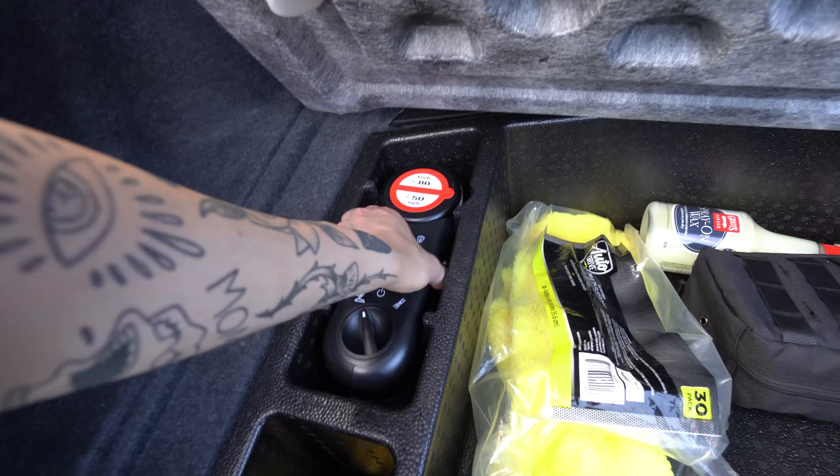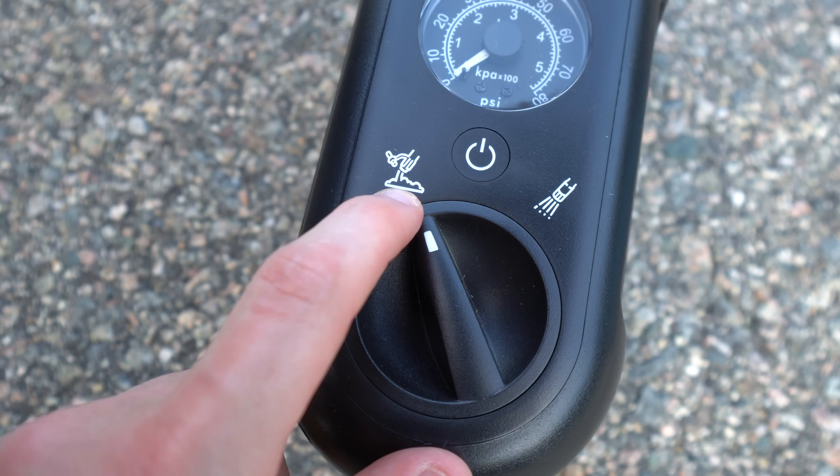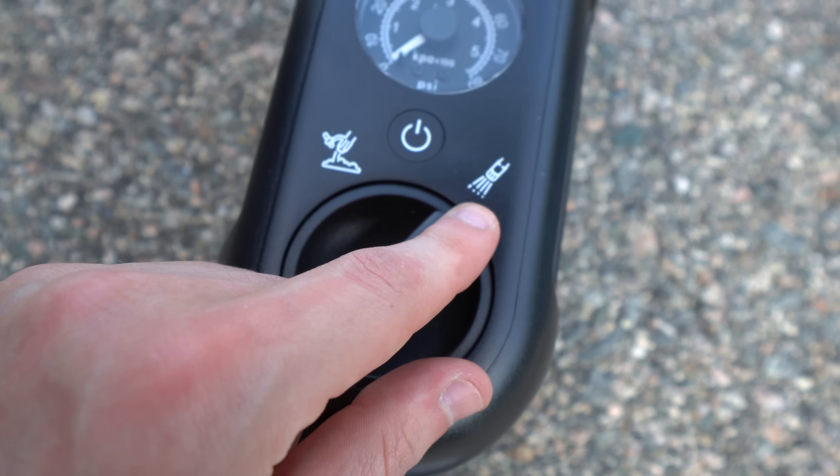While you're in the under-tray compartment, you're going to find your fix-a-flat slash air compressor kit. A lot of people didn't know what this was for or how to use it — you can actually use this as any other air compressor to fill up your tires when they're low, on the go or at home, because it just plugs into the 12-volt outlet in your vehicle. It has two modes: one pours fluid through a tube to spray into your tire to fix a flat and seal it enough to get home, and the other is just a regular air compressor. Note that after using fix-a-flat you shouldn't drive above 55 mph or long distances — same as a donut. It's also great for filling inflatables, balloons, or bike tires wherever you are.